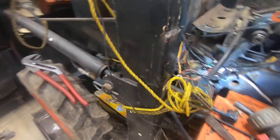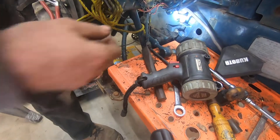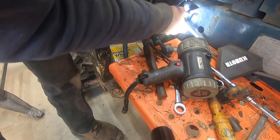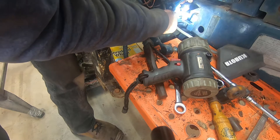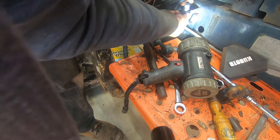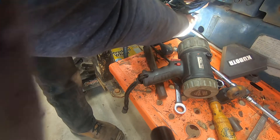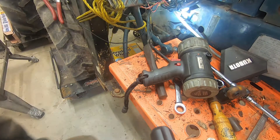To adjust this, I've got the clutch pedal tied forward all the way so it's as if the pedal is pressed as far as it'll go. And now you want to have this clutch switch pushed down all the way and compressed as far as it'll go. When you do that, the switch will disengage when you've pressed the clutch. So that is how you install the switch.